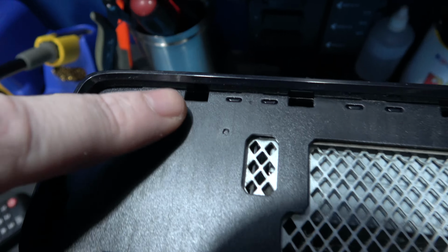RGH modded Xbox 360 Slim, and as you can see, there's my CPU key. Yeah, why not? So what I'll do now is I'll get my PC up top and everything again, and we'll get the CPU key, generate that glitched image, and then program over the NAND. So yeah, back in a little while.